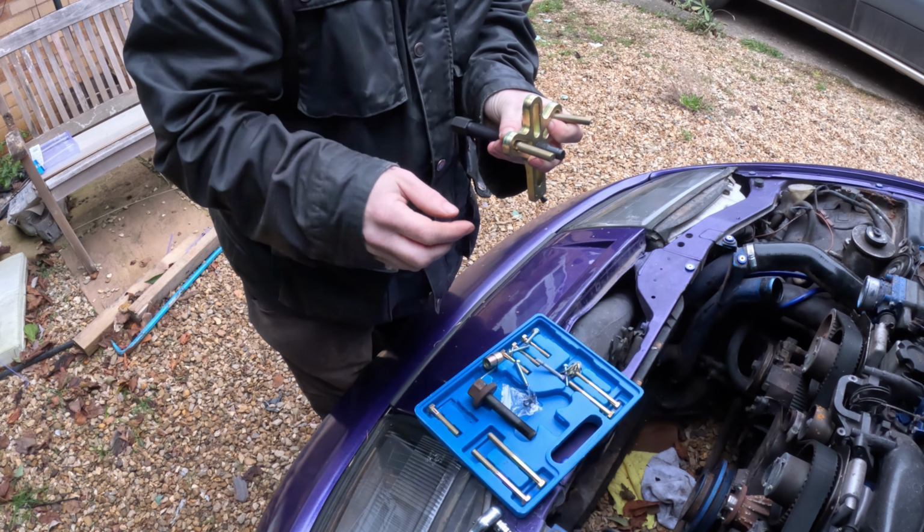So what you've got to do is make sure that these bolts are in an equalish amount so that it's pulling it evenly. So that's in the top thread, that's in the bottom thread, and this big bolt here is lined up on the end of the original bolt. On the end here, this is a 19mm, but obviously that's going to depend on the pulley you've got. So what I need to do is return this. Hopefully it's going to...